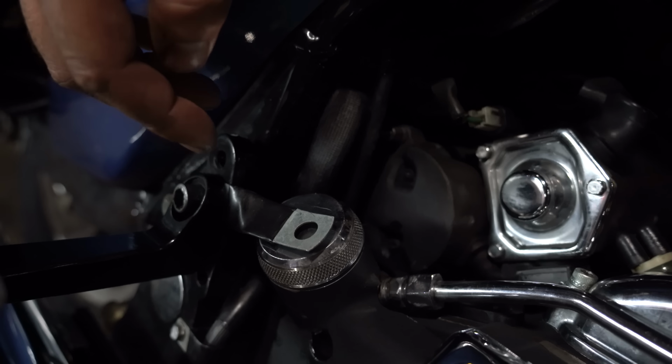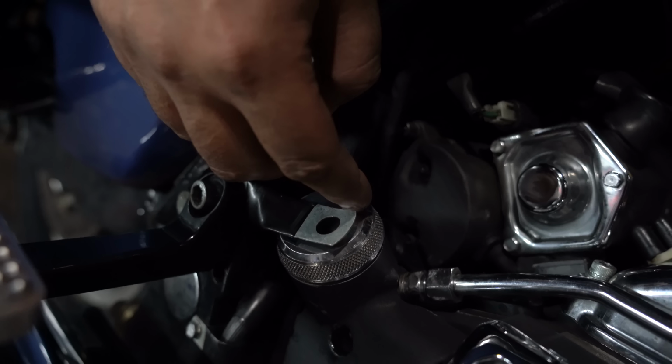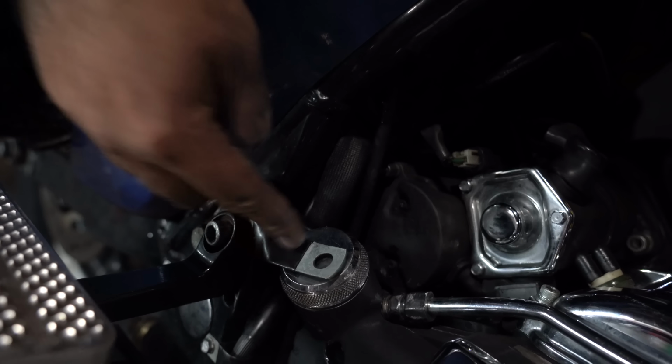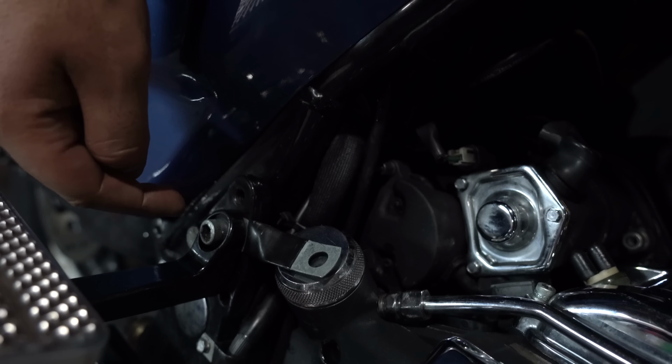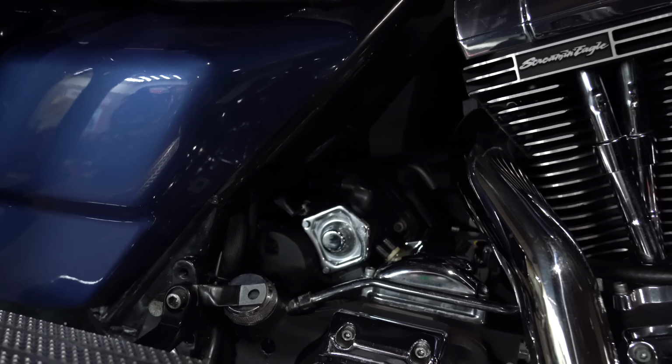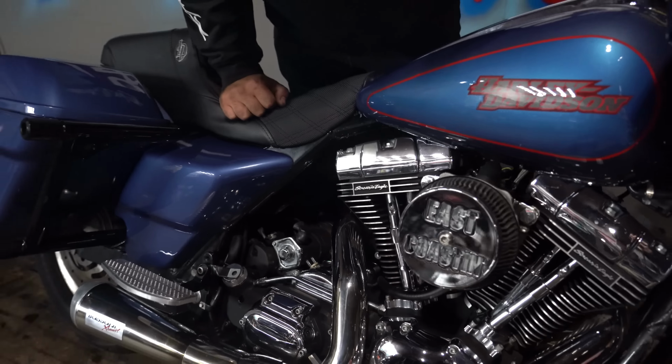Baggers, a lot of the time when you wheelie, they pressurize in here and they shoot the dipstick out. So I just got one of these mounts that hold a cable and just drilled it and bent it in, and honestly it worked pretty good. There's a lot better ways to do it, but that was quick, easy, and effective.